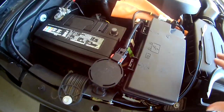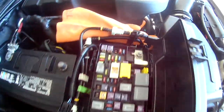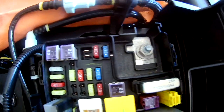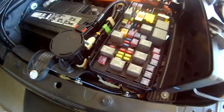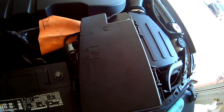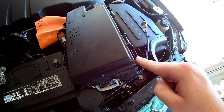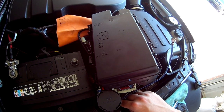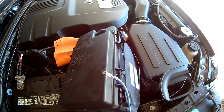Next, we're going to open up the fuse box - there are two clips, you just press them and it opens up. We're going to disconnect the power to it. There are going to be four clips, and on the back here you're going to pull the whole box out to be able to get to the connector back side. I disconnected the power cable, released the tabs, and pulled the whole box out. Would have been a little easier with two people but still pretty easy on just me.